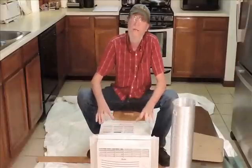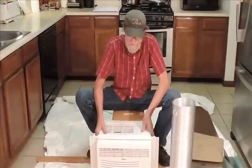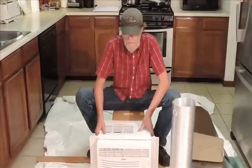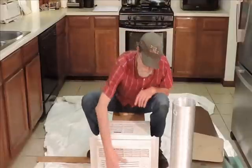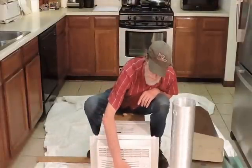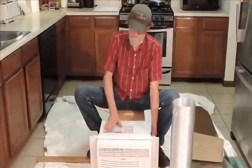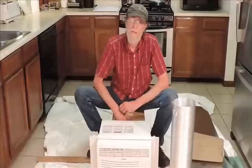This video shows how to take a small inexpensive window air conditioner and operate it inside a room — in this case, on a boat. For those not familiar with how these units work: it pulls in air from the front and blows out cold air through the evaporator coil. In the back, it sticks out the window so outside air comes in the sides and exhausts through a coil called the condenser.